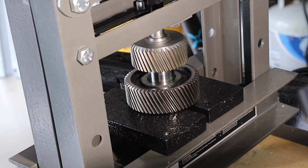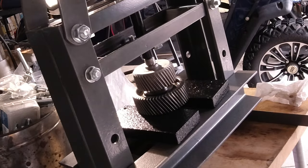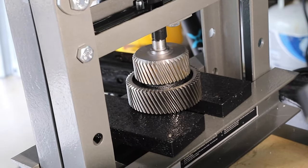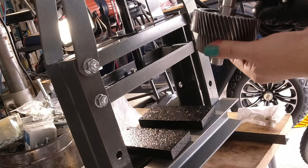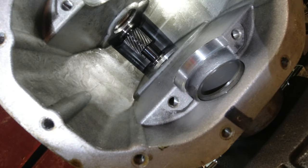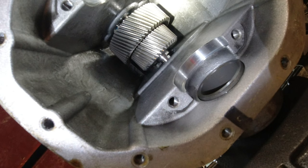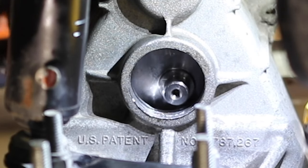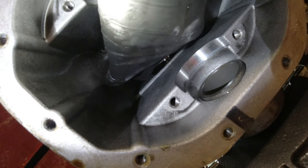Next I'm going to take my press and put the gear in with the new gear I wanted on there. Unfortunately the plates holding it down were a little too close to allow the shaft to slide through as I was using the jack to push it down, so it popped out. Once I figured out what happened I went ahead and completed the bearing press process - the six-ton press worked out really well. Next I'm going to take this intermediate shaft and slide it into the holes where the freeze plugs came from. The snap ring has to come out from the other side with the motor. You really need two people to help with this process because it's almost impossible to hold that gear up, line it up, put the bearings on, and hammer the bearings in over the shaft all at the same time without three hands.